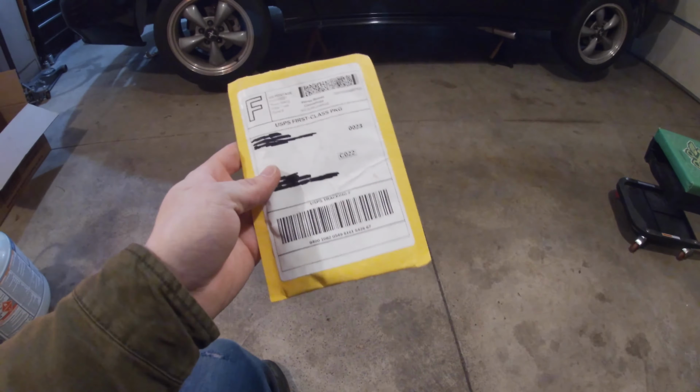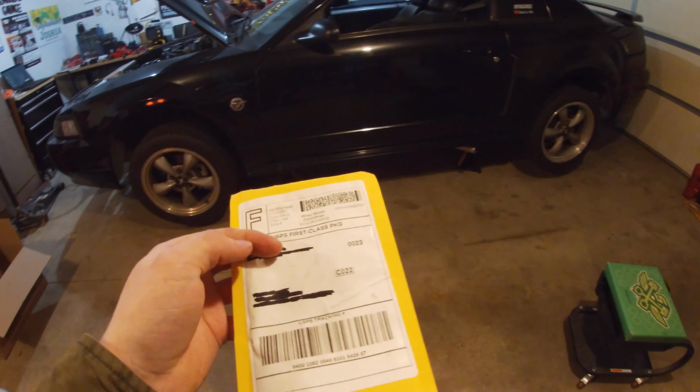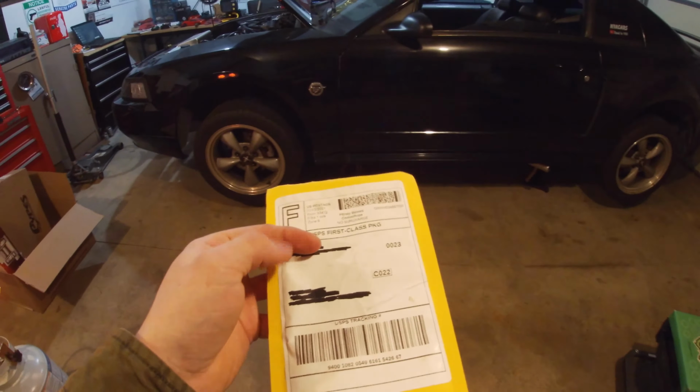And even though it's obviously black, it's not the glossy black, it's just a textured plastic black. But what you do is you just take a bit of fine grit sandpaper and sand the top, and then take touch-up paint, like a little bottle that you can buy that comes with the brush or a tiny tip, and then you just touch it up once it's on the car, or you can do it wherever, it doesn't matter. So we're gonna probably do that so it doesn't stick out, or so it blends in a little more. But enough of me rambling on, let's get this wing off.